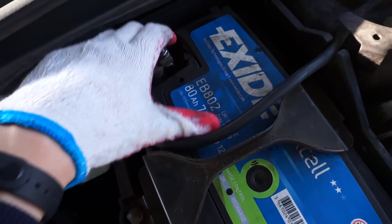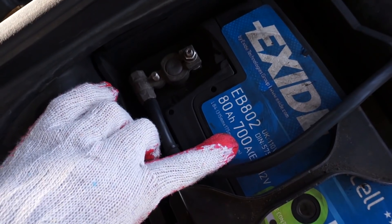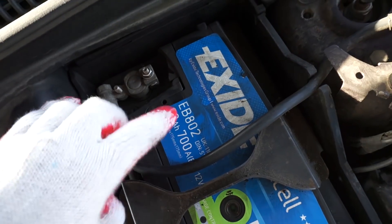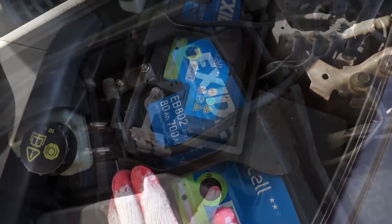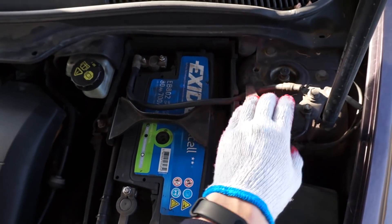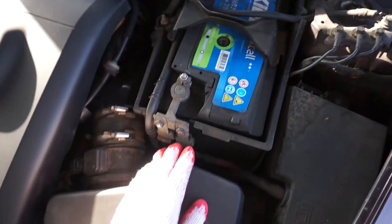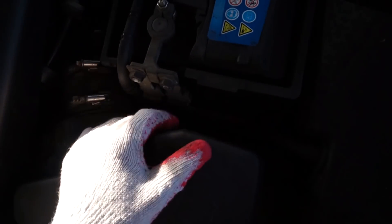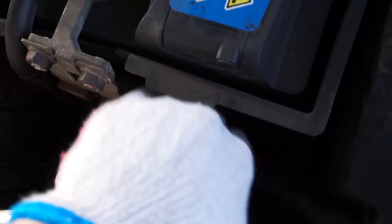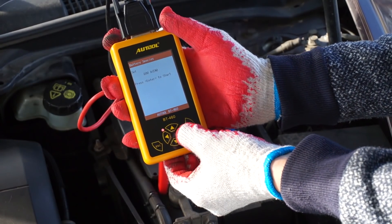Okay, now let's go to the Volvo. We will check cold crank amps and starter voltage. The first thing is to check the CCA value on the sticker, then check which terminal is positive and which is negative. If you cannot see the color coding on the battery itself, check which terminal is connected to the chassis — that will be the negative one. As you can see here the wiring is in red but it's so dusty you could easily miss that.